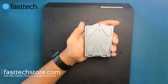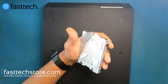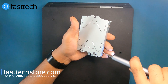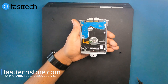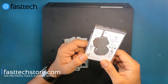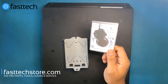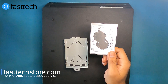You can buy this hard drive from our website with the enclosure or without. If you decide to buy it without the enclosure you're going to have to reuse your old enclosure, which you can do by removing these four screws on the side that hold the enclosure onto the hard drive. Then we're going to lift the hard drive out — as you can see this is a Seagate 1TB hard drive. We sell 1TB, 2TB, 4TB, and 5TB options, and we also have SSDs listed on our website. When you replace the hard drive you're going to have to reinstall the system software.